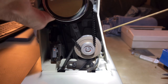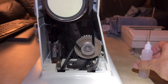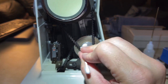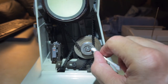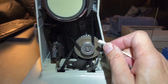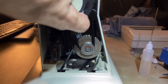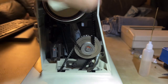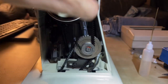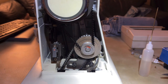I'm going to put one drop right there - notice that the pulley is turning and it turns around the centerpiece. Just one drop - boom. You see it sort of flowing around. Now mop it up - I just wanted the oil to soak into that drive shaft joint, that's all. It doesn't take much because there's not a lot of room in there; that's why you started seeing it run around the rim. The machine will appreciate it. I've mopped up the excess and anything I needed is already in there. If you don't ever clean your pulley you may never notice it, but I want this machine to continue to be an heirloom - that's why I go to this extent.